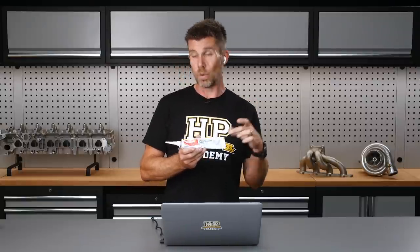What I really wanted to talk about is the sealant we use on our engines. What I kept seeing was a lot of engines come through the door where the sump, rocker cover, or front cover had been sealed to the block with big dobs of orange silicone hanging out, which just looks really ugly. What I always try to do is replicate the factory sealant look, which will almost inevitably be a grey sealant and requires a specific product to achieve. The one that a lot of OEs use is 3-Bond — this specific one is 1215. You'll find that the factory workshop manual will specify what type of sealant should be used.